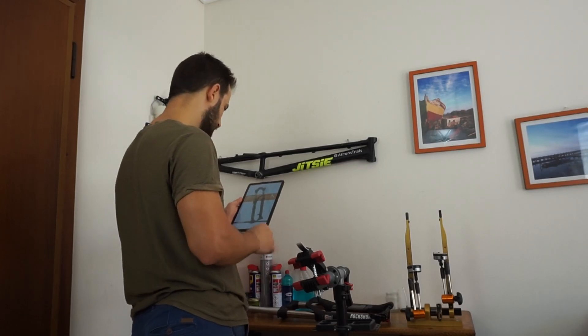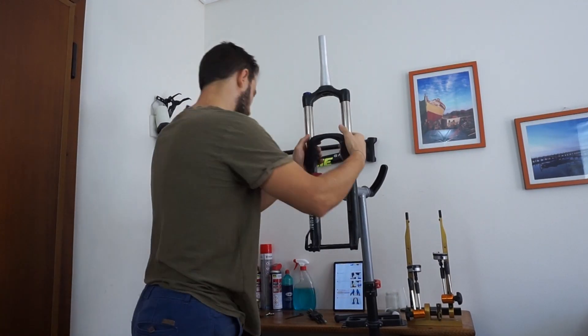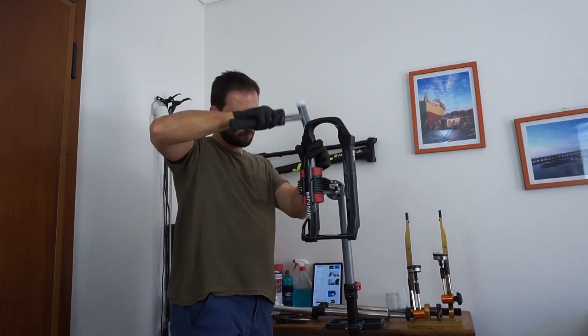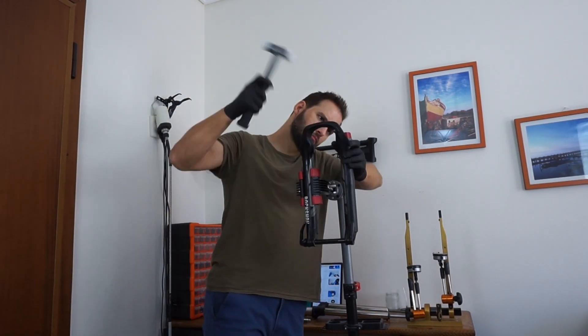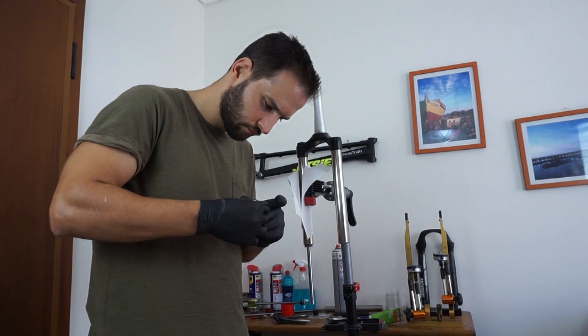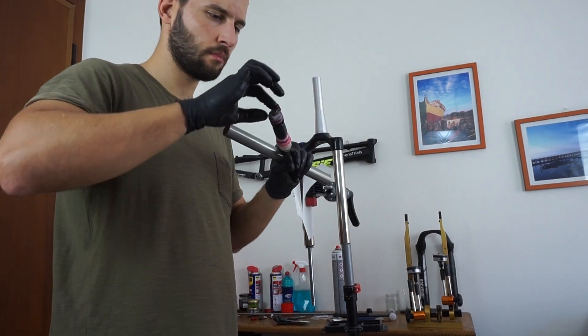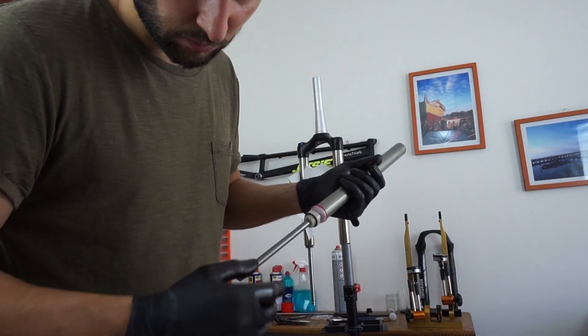I know that if you've messed around with many different suspensions you already know the ABCs to handle almost everything, but I strongly believe that even then a quick look into the specific manual of a suspension could potentially save you from mistakes down the line. So for this one I visited the Rockshox website and found the specific manual for this suspension fork. I read it quickly and also kept the manual open during the maintenance procedure to verify that I was doing exactly what was needed. Some very useful information I could only find in the manual was the amount of oil required for both the air spring and the damper, and of course the tightening torques specified during the maintenance procedure.